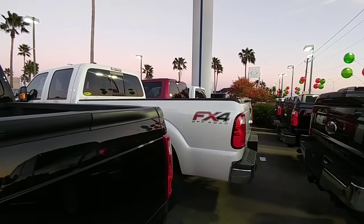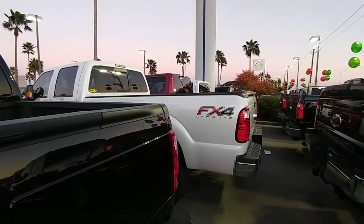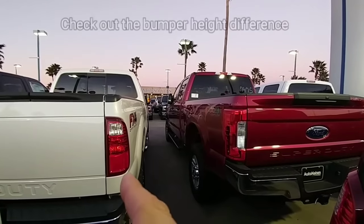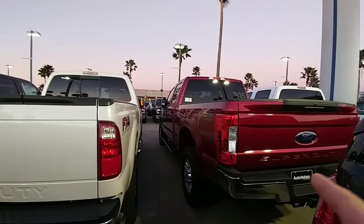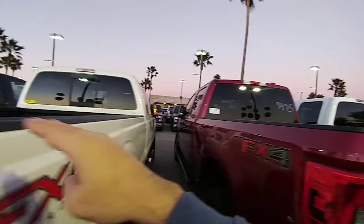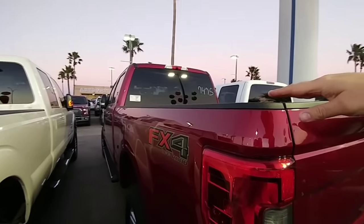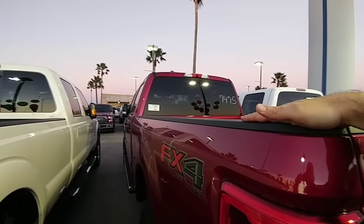This picture demonstrates perfectly the height difference between an F-250 and an F-350, both single rear-wheel trucks. And here's the height difference between a 2016 F-350 — which has the taller blocks and sits higher in the back — and a 2017 F-250, which still sits about an inch and a half taller at the bed rail than the 2016 F-350. So you can see where some folks might have challenges hitching up to fifth wheels, simply because a lot of fifth wheels don't give you much hitch adjustment to compensate for the increased pickup truck heights you're seeing now.